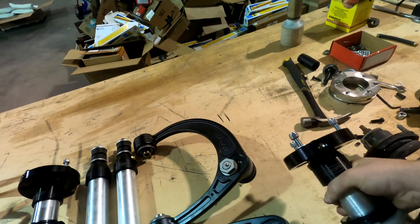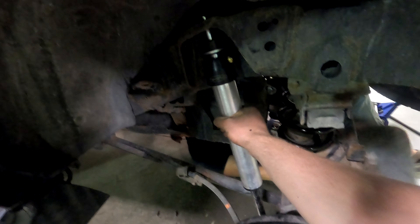Here's our progress update: we got our Rad Flow rear shocks mounted at the bottom and our All Dogs Off-Road coil springs installed. We don't have them connected up top yet to have more room to work, but once that's done we'll drop it down, torque it down, throw the tires on, and see how she sits. While we were back here we also decided to delete the rear sway bar — the end links on it are bad, so might as well.